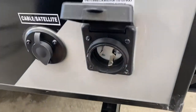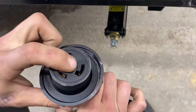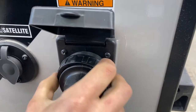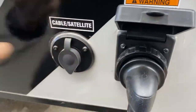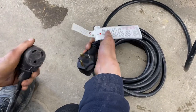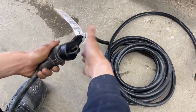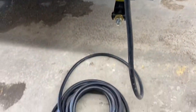From there in the back corner, you're going to find your power connection. Pop it open, there's a little notch in the bottom corner that lines up with the notch here. Press it in, give it an eighth turn to lock it into place, then the threaded collar locks it down. Following the cord back, you'll find a standard 30 amp end — most campsites will have that so you can plug straight in. We also provide a 15 amp adapter so you can plug in at home to charge your batteries or run your fridge.